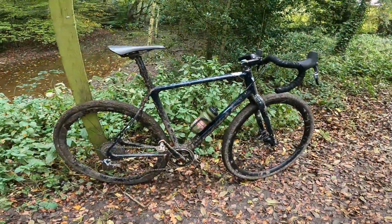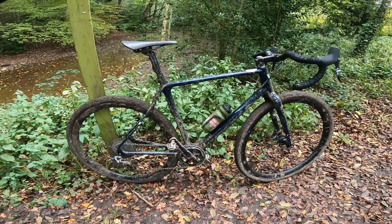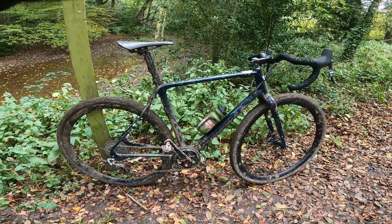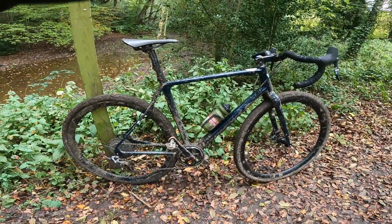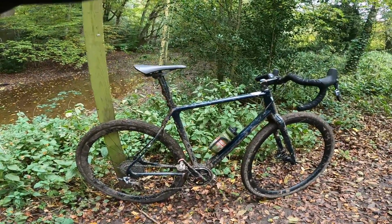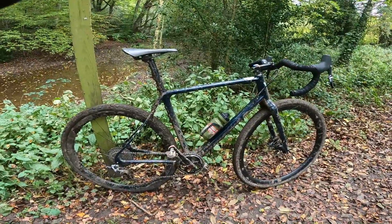Sorry, just to add a bit more feedback, I wound it up on the way home, and although they're a little heavy, that freehub responds really quickly, and once you get them into their stride, they've got a really nice firm feel under power, so they're a really nice rouleur wheel. They really hold speed well once you've got them up to speed. As you'd expect with 24 spokes front and rear, that relatively firm feel also translates into a nice accurate tracking and steering character. Oh, and for the record, running 30 psi in these, and I haven't had a single worry about burping or wallowing or sliding around. That bulked up profile really seems to work with these tyres.